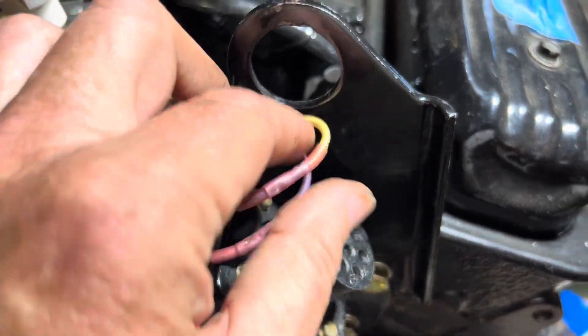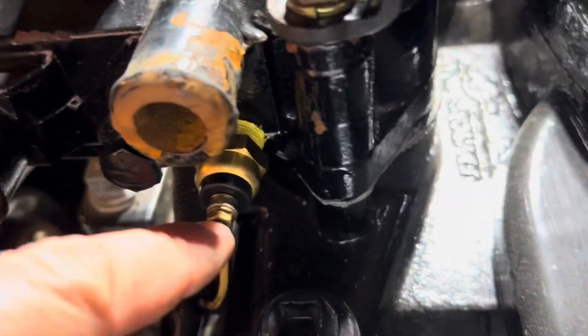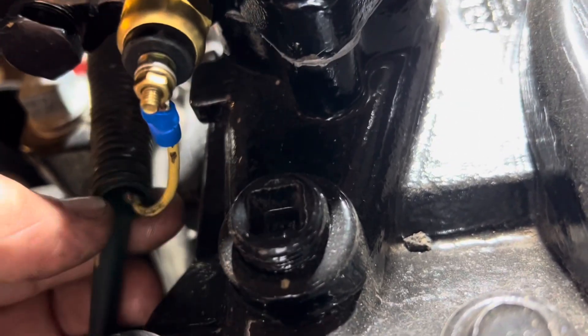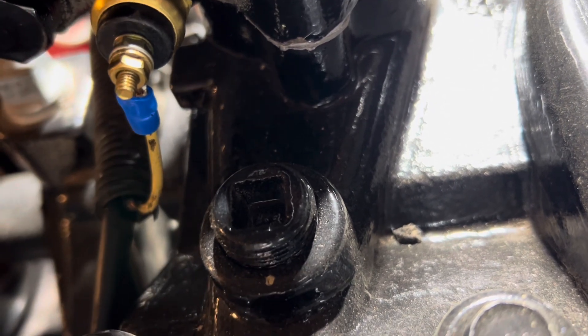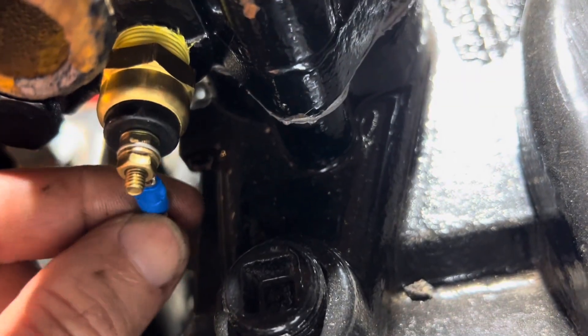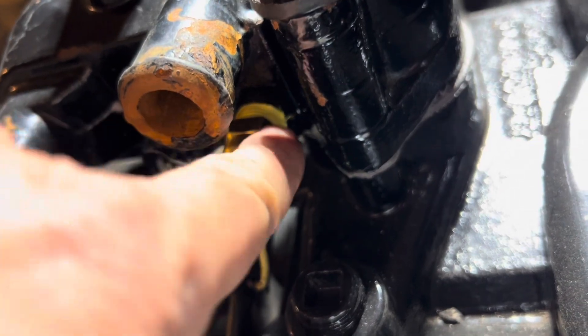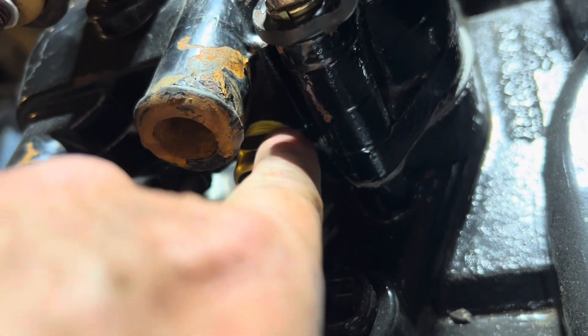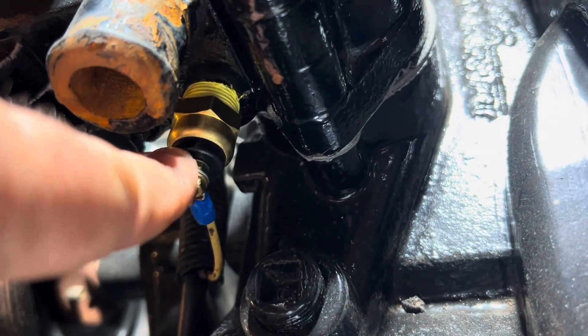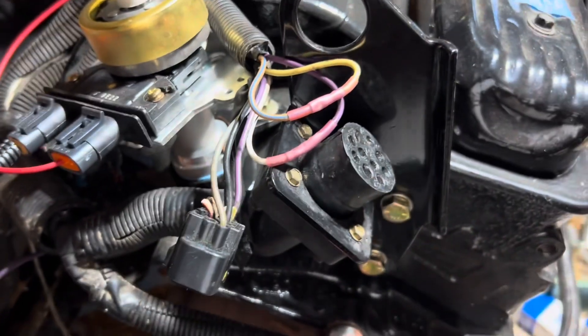The tan with blue stripe is tied into the yellow up here on the front. There was a temperature sensor right here with a yellow and a black wire with a plug-in connector. I cut the connector off, cut the black wire back — it's a ground, it's okay if it hangs loose. On the yellow I put a ring terminal and connected it to a new temperature switch in this hole. This is a switch, so make sure you've got a ground connection to the thermostat housing. Even with Teflon tape on the sensor it still makes a good enough ground connection. Don't put too thick because you need contact between the brass switch and the cast iron housing or your alarm won't work. That's your temperature over-alarm switch.